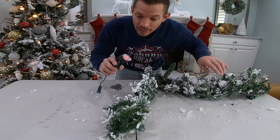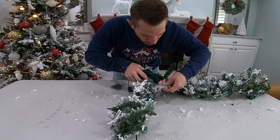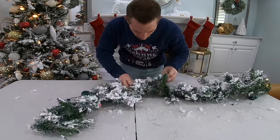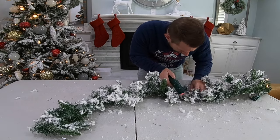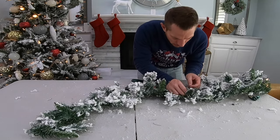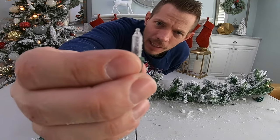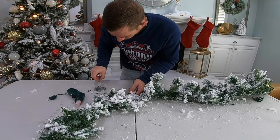One of the notes it gave is that if you plug it in and start testing and you're only getting a red light signal, check the fuses at that point. But since I'm getting a green light signal on certain bulbs — well, I was — somewhere we've lost it. That's a good sign. That means somewhere back in here is probably our bad bulb, so we'll go back until we get a signal. Got green, green, and green. Those are the last two that are good. Let's replace this one. All I know is they just like to be a pain in the butt. Here we lose it — and that one's totally burnt out. It's very visible. See that black hue at the bottom? It's totally burnt and fried. Maybe that's the culprit.